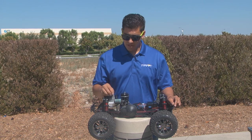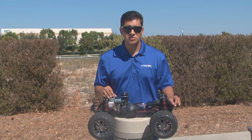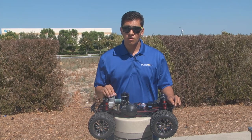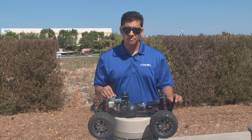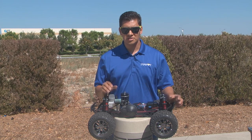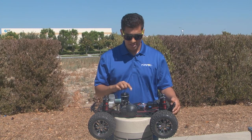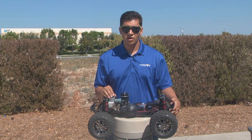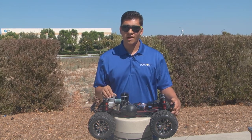Another good thing to pay attention to is your air filter. Make sure your air filter is clean of any debris, any type of interference, and make sure you get good constant flow. Also, it's completely normal to have plenty of smoke and oil coming out of your exhaust during break-in. The last tip I have for you is pay attention to your battery voltage. If your truck is running extremely rich and doesn't seem to want to stay on, check your battery. If your battery is dead, that will cause the CDI to misfire and cause your engine to run poorly. Charge up the battery and it should be ready to go. Thank you so much for watching the video, good luck with your truck, and we'll see you out in the field.